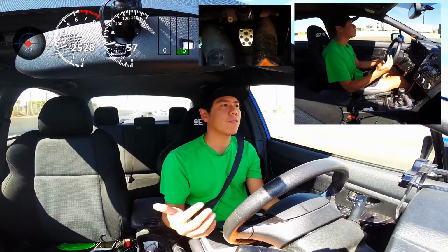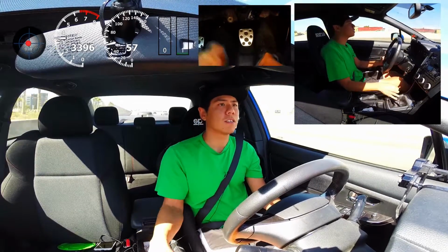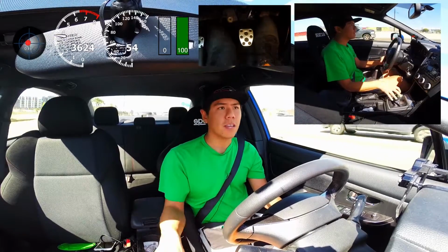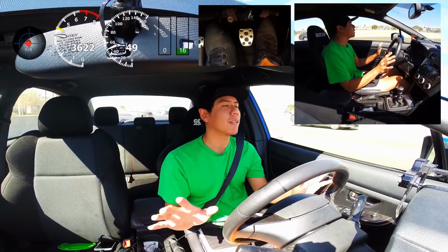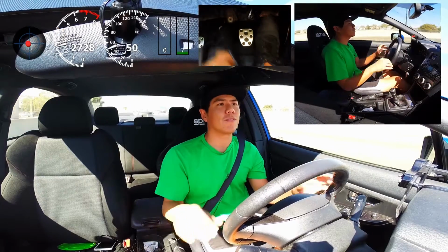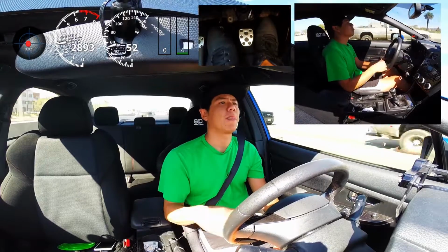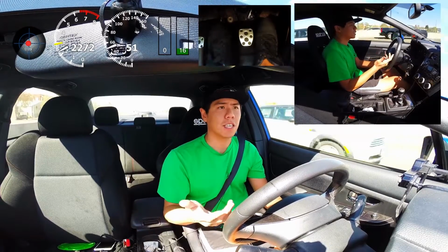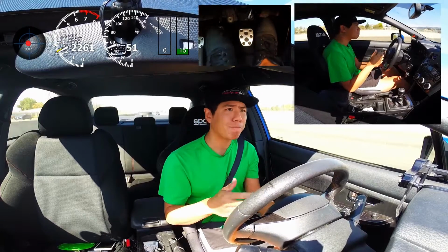Every car is going to be different. Gear ratios are going to be different. So it's just good practice. So just doing that all the time, right? Don't worry about the brakes. Just focus on how much you need to blip the gas to get it to go into the next gear, to match the RPMs that would happen in that next gear at any given speed.